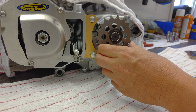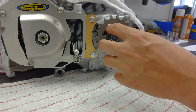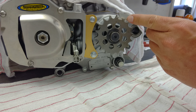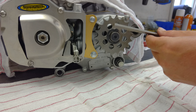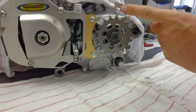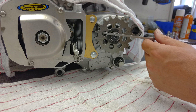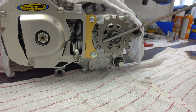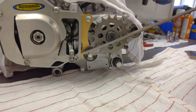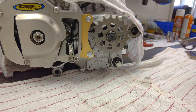Now to take it off when everything is installed: I like to rotate the clip so the top of the clip is in the nine o'clock position. You're going to take this little tit — and that is going to go on the inside of the clip, between the bushing and the clip. Just give a light tap, and it's captured. Pull this away and then you can make a gear change.